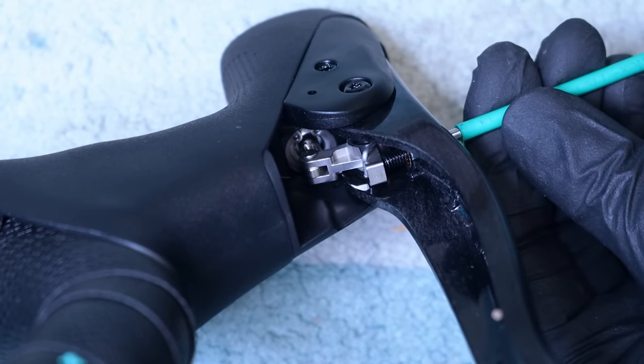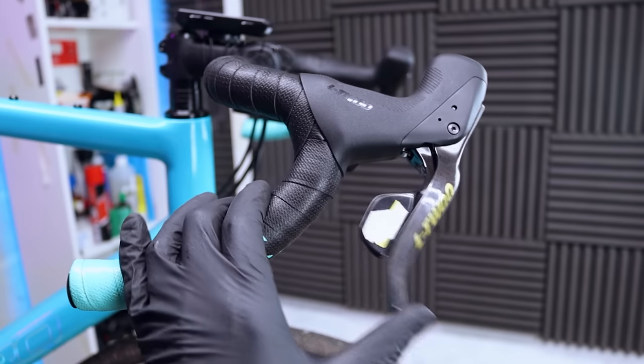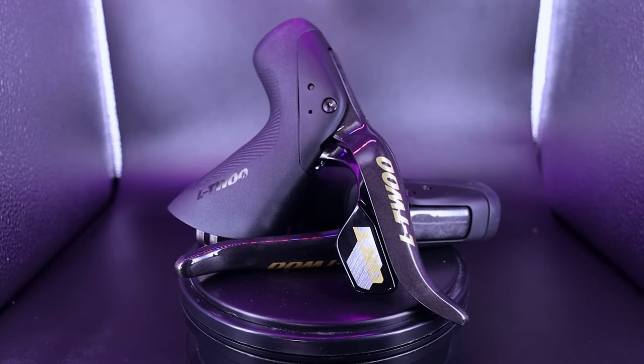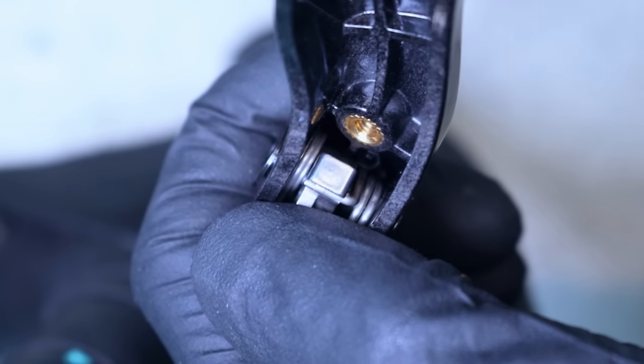Second small issue: free stroke adjustment and brake lever reach. You can't change the brake lever reach — the distance between the lever and the handlebar is fixed. The free-stroke grub screw pre-depresses the piston via a camming mechanism, reducing lever throw before the pads hit the rotors. Fresh out of the box the lever throw is quite large; screwing in the grub screw reduces it. Also, the grub screw is not captive — screw it in too far and it falls out the back, requiring lever removal to retrieve it.